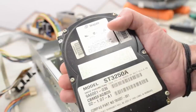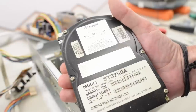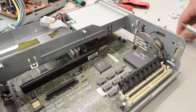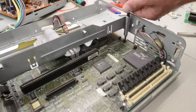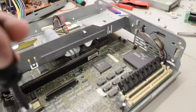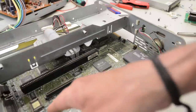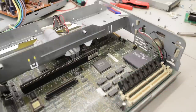It's an ST3250A with Compaq numbers, so this is probably the original drive — 213 MB. The diskette drive has Compaq numbers too, so that's probably original as well. Luckily I've collected these original Compaq screws over the years, so we've got replacements to make it as original as possible. I think I have a decent guess as to what these empty pads might be, because the article I read at the beginning says these machines had built-in modems, and this machine doesn't — so at least some of these pads are probably for a modem.